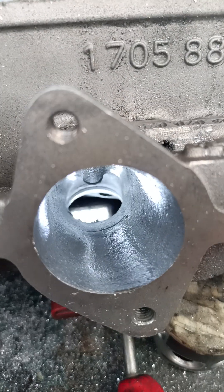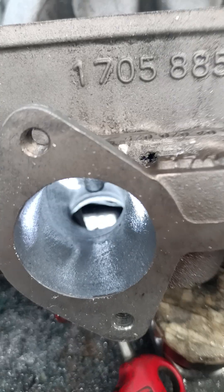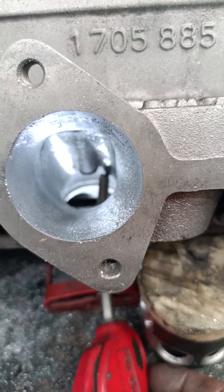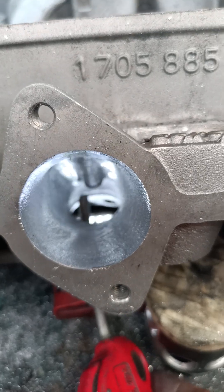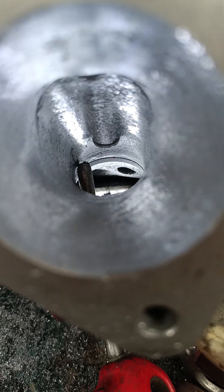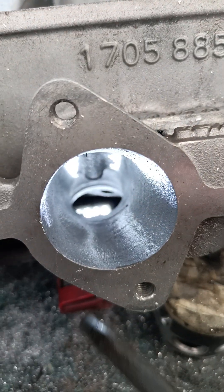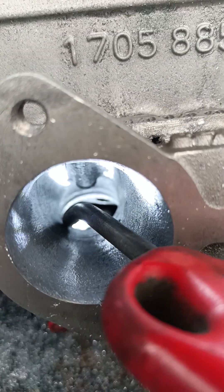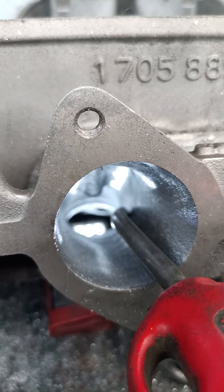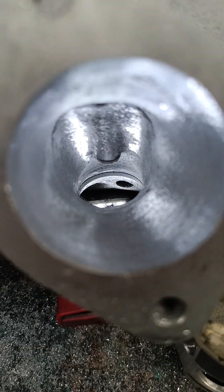Without a flow bench, you're not going to be able to learn what the head actually wants. If all you're doing is cleaning it up, just clean it up. Some cylinder heads will benefit from a roof cut around the guide boss, others will benefit just from a really nice valve job that'll guide into the bowl and blending that valve job into the bowl. With the 885, take a bit out of this area and a bit out in the short turn, do a bit of guide boss reduction and just a nice bowl blend. Other than that, this head will flow really well.